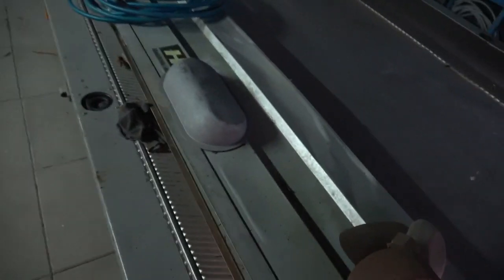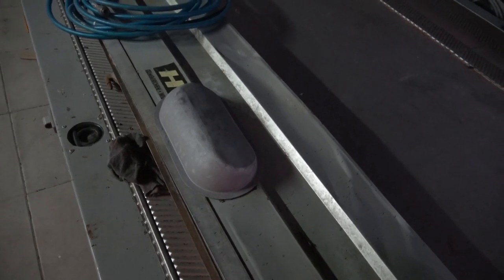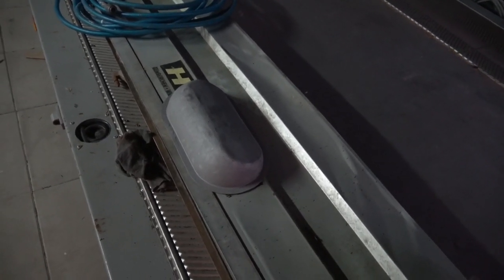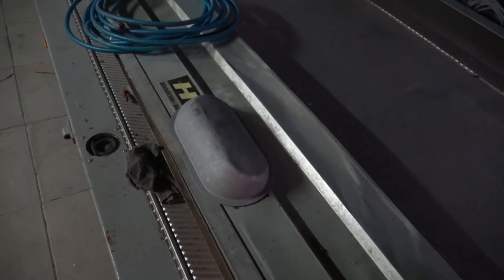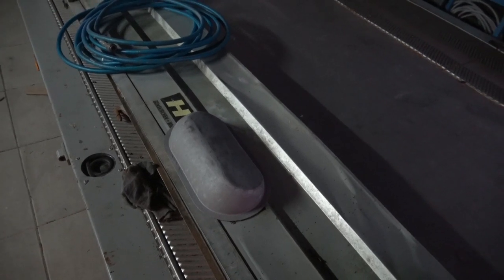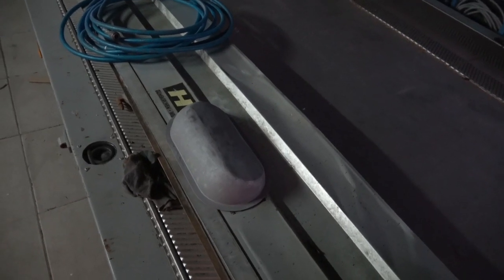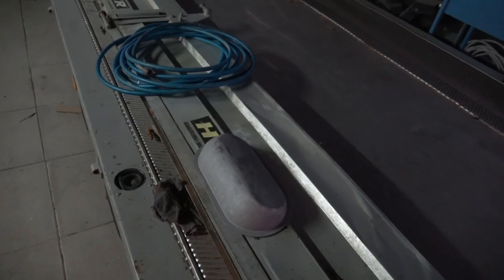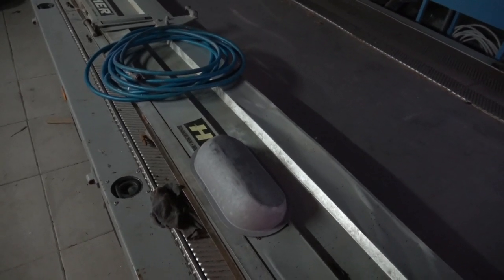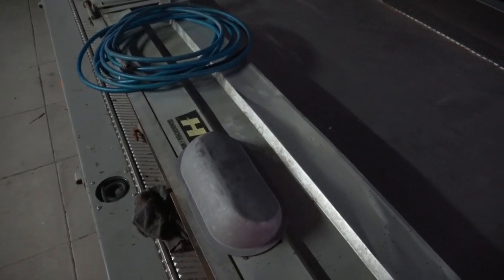So I'll take this up and I'll give it a bit of paint. Because if you sandblast this, literally within 24 hours, even in a reasonably dry area, you'll start getting micro rust on it. It's bad enough if you are rubbing down a car and you don't put some primer on it quickly. You'll get micro rust on it, but even more so with sandblasting, because all the grit's gone right into the little, tiny areas that you can't get to with a flat piece of sandpaper. So I'll take you back up and I'll show you after I've painted it up.